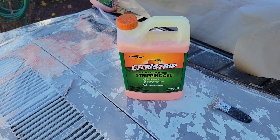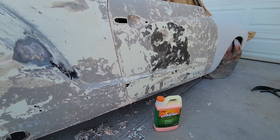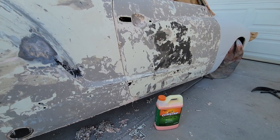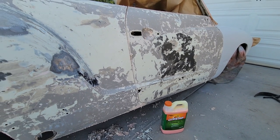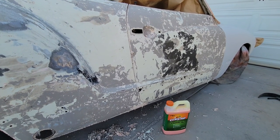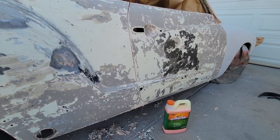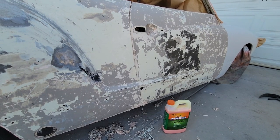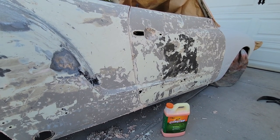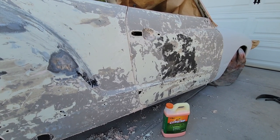Let's look at the good and bad about using citrus strip. When used properly, it works pretty good to remove even some of the original paint, but it works best if you use it to remove particular products on your car. If you're trying to get paint off and it doesn't work, it might not work well with clear coats or paints put on with clear coats — so later model cars might be a problem. For older cars it actually works pretty well, like taking off old synthetic enamel from old paint jobs like a Maaco or one-day paint and body that have failed, getting it back down to the original paint to sand and repaint.